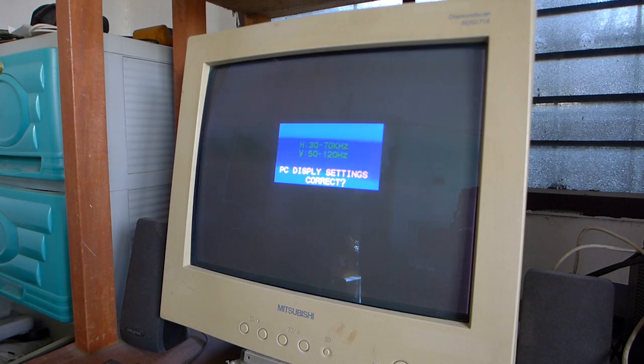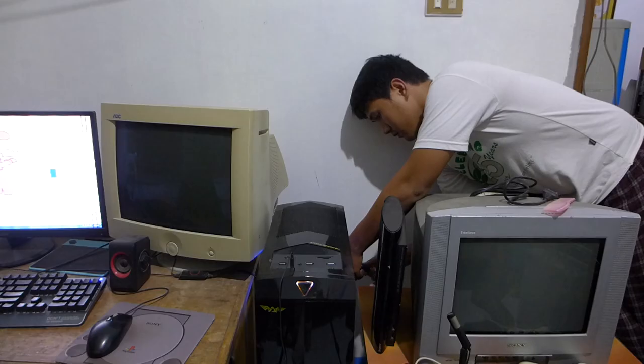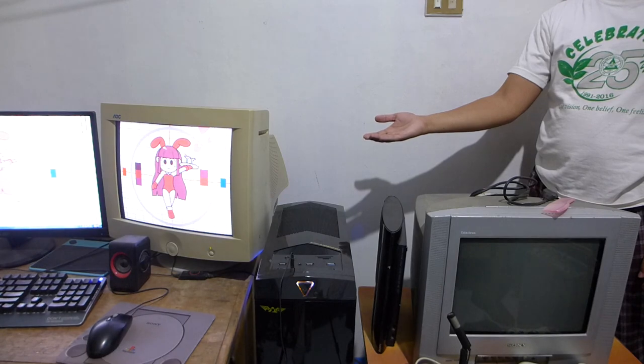Both monitors have the same supported horizontal scan frequency of up to 70kHz, which is common on most 17-inch CRT monitors in the mid-2000s. I'm still using this generic HDMI to VGA adapter since my 1050Ti does not have any analog outputs anymore. Interestingly, this adapter supports an interesting number of video modes including non-standard modes, which is going to be crucial for this setup. There's this annoying issue where I have to disconnect the monitor from the adapter and plug it back in to get the graphics card to detect the monitor — I think this problem is specific to this monitor but I haven't investigated it much.